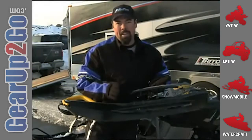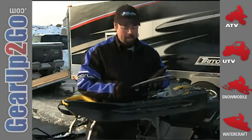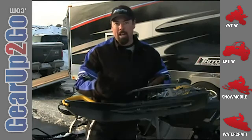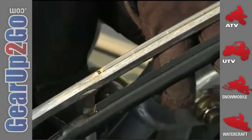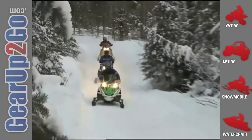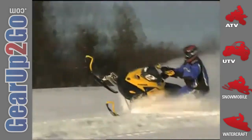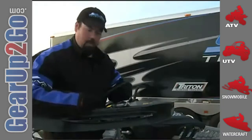Even if you don't run studs in the track, your sled may still benefit from a slightly more aggressive or even a different shaped runner. For those of you just getting into snowmobiling, the carbide is an actual piece of super hard material that's been embedded into the steel runner that gets bolted to the bottom of your ski. This determines pretty much how aggressive the ski is and how much bite there is when you come onto icy surfaces. The stock carbides are okay, but we're going to upgrade to a set of six-inch Woody's Trailblazers to better balance out the studs already installed on the track of this Rev. Determining how aggressive you should go is really up to how and where you ride — if you're in the powder all day long, more carbide isn't going to do you much good.